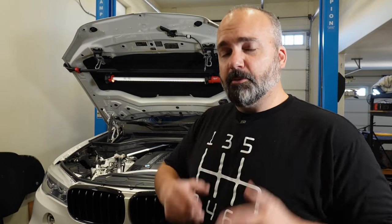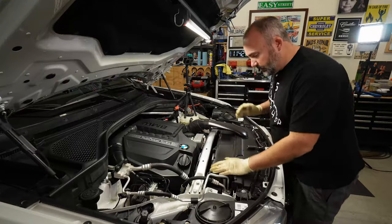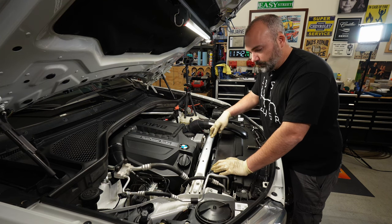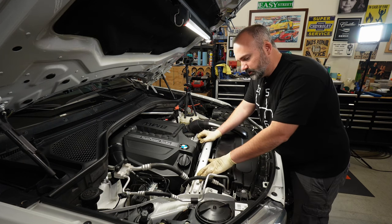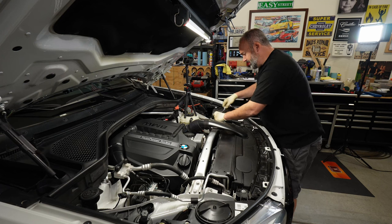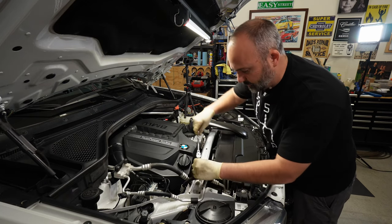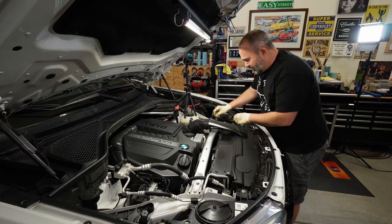Let's talk about the tools we're going to need for this job — we'll cover them as we're pulling it apart. To start, we need access to the belts. On the X5 it's going to be easiest from the top. We need to get the intake snorkel, this transverse stiffening piece, and our fan out of the way. The repair instructions say these bolts are one-time use — they're 10 Newton meters and then a 90-degree torque. These are those bolts I mentioned that I forgot to order. I already checked them with a magnet — they are steel — but with that torque specification they're likely stretch-yield bolts.